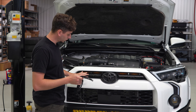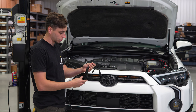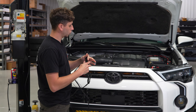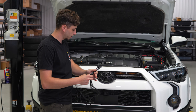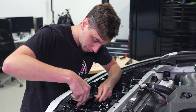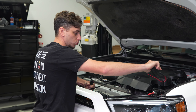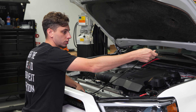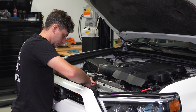We have all four raptor lights in the grille now, so we can go ahead and put the wiring harness in. We'll plug in the lights first. We have a bunch of extra wire — we'll route that through behind the grille, behind the headlight, and up to the battery area. We'll bundle up the extra wire; you can cut it shorter if you want, but I'm just going to give myself enough length to reach over to this corner and get it zip tied up.